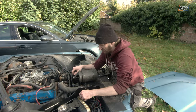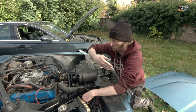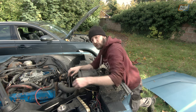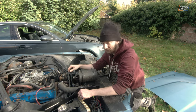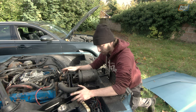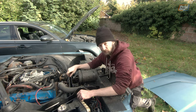Fast forwarding a few minutes to the end of the easiest starter motor removal I've ever done in my life - it was three bolts on the motor and one to release a K-frame support, and it just dropped out really nice and easy. Aid confirmed after I picked it out it does still turn really nice and easy, so it's probably not seized in the actual motor assembly. It might be the solenoid on the top that's seized. We're going to bung it in one of our big bench vices in the garage, put 12 volts into it, and see if it spins on the bench.